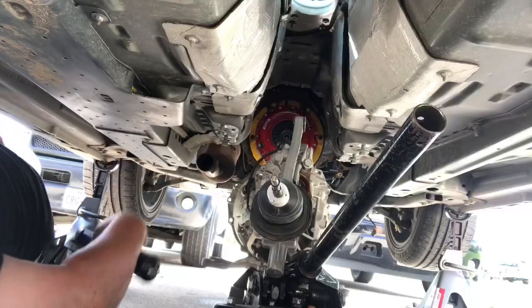I'm about to get under here. I'm gonna grease up the dowel pins, the alignment pins on the bell housing just a little bit to help it slide on easier. McLeod recommends that you do not grease the input shaft because you don't want that grease slinging off into your friction pads, your clutch discs, and ruining them. I just did a very, very minute amount just to help. Like I said, do as I say, not as I do. I'm gonna go down here, slam this transmission home, and hopefully it goes in easier than it came out.